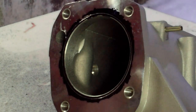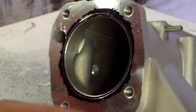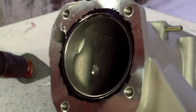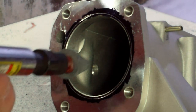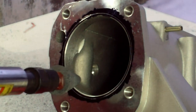Next time we see it, we will be grinding. Alright guys, it's going to be a little hard to understand me. We've got our simple grinding wheel — bought these from Harbor Freight, it's a five-pack set for about five bucks. I should probably be using a tungsten carbide grinding bit, but I'm only taking about two millimeters off so I think I'll be alright. I do have a dust mask going, that's why I sound a little funny.